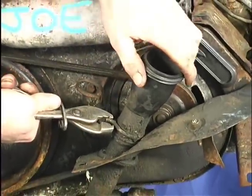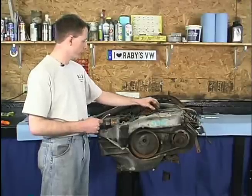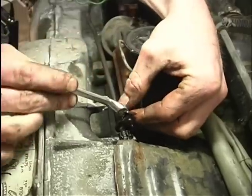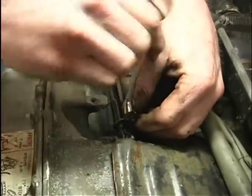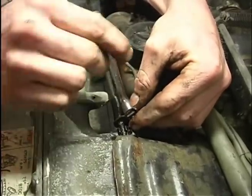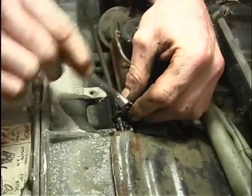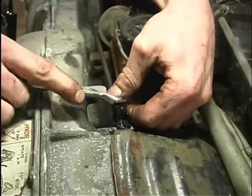Compress the ring and then pull the tube — sometimes they're a lot harder to come off. There's a seven millimeter bolt with a small tab on the back side that clamps onto the cable. Remove your seven millimeter, just loosen it up enough to remove the cable, and then have a friend remove it from the bottom. Pulls out like so. Be sure to keep this in place — you don't want to lose this.